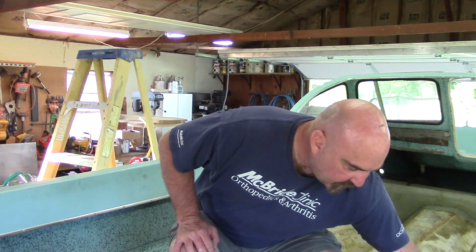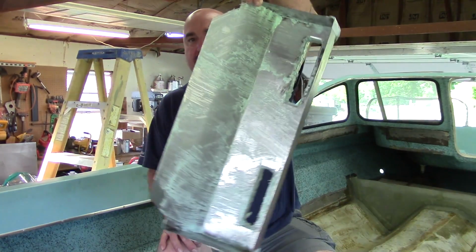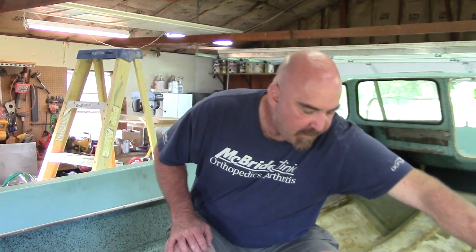And one of the reasons why was this funnel. I mean, it worked great. I've said this before, the key to seacast is having all your ducks in a row, having all the tools and equipment there, because once you've catalyzed it, you're pregnant. But that being said, we had at least an hour today to get the stuff in the hole. We were able to get it in the hole in probably 10 minutes per 5-gallon bucket once we got it mixed up. So it wasn't a big deal. The key is just being prepared.